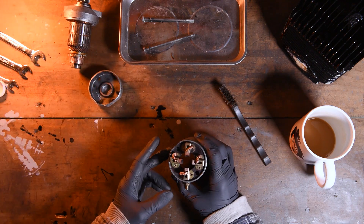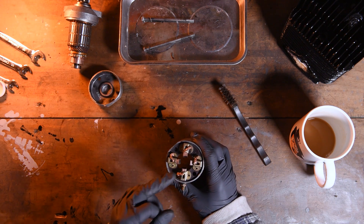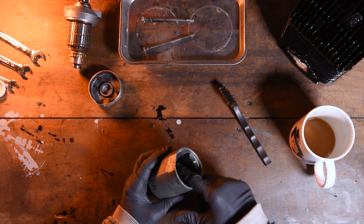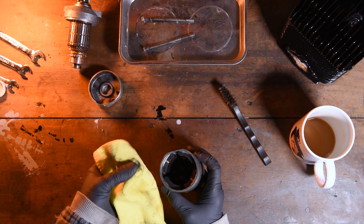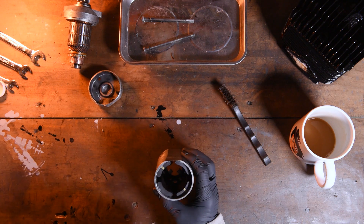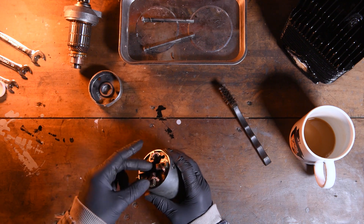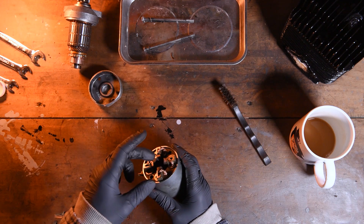As your armature spins round inside your starter motor it makes contact with these brushes, and as you probably guessed they wear down and leave a coppery carbon dust. This one isn't too bad but it can get to a state where it's absolutely caked on inside here. For demonstration purposes it's all black carbony stuff like this that will come out. So I'm going to spray some intake cleaner inside there just to clean off what little is inside and make sure this is as best as it can possibly be. You can also clean the faces of these brushes, but it's not really that necessary because these faces wear down and they've usually got a pretty clean surface.